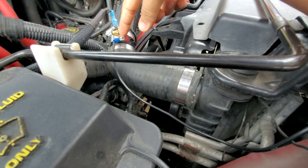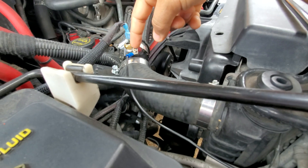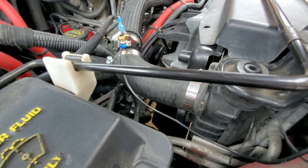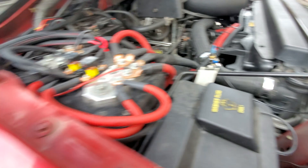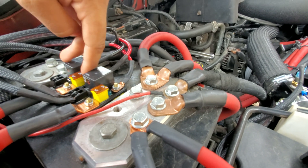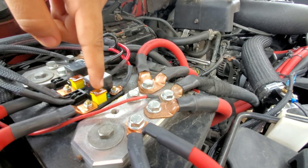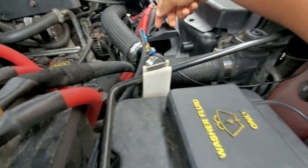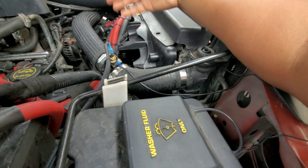I went with the 180°F sensor because it turns on up until 188°F. I tried the 190°F but it turned on way too high, so I went with the 180 and that worked. For the relays, I'll leave links — these are Leash Electronics relays, 70 amps, and I went with 60 amp fuses. To hook up the e-fans, go to the junkyard and buy the connectors for the e-fans — just look for a 2012 or 2013 F-150.